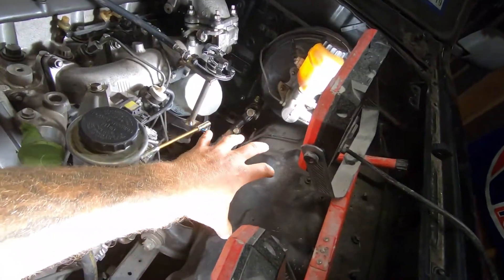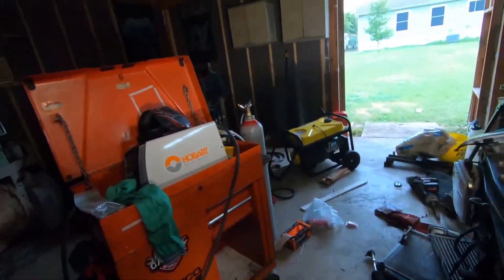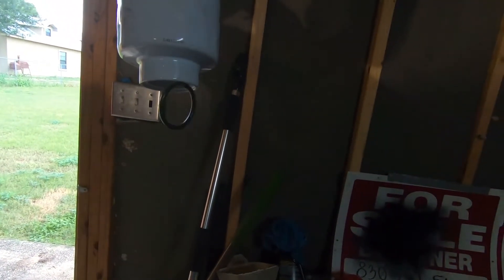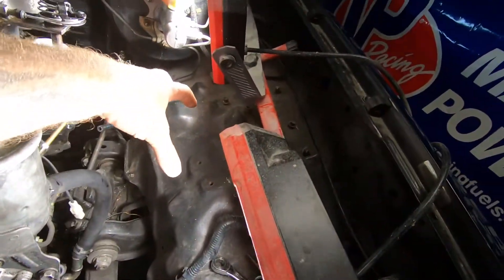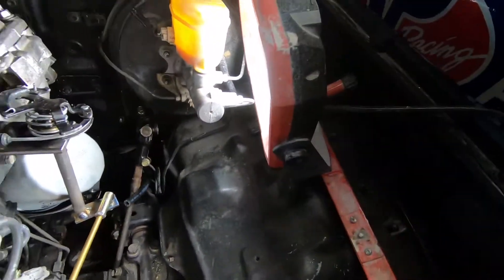Next I'm going to be working on the fuel system. I'm probably going to have a fuel pump, make a mount for the fuel filter — I've got the fuel filter housing shipped in from overseas. I was able to get this Wix fuel filter from O'Reilly's, it's the 33138. It does not come with the bottom fuel water separator sensor; I did find one at NAPA that's supposed to be coming in tomorrow. So hopefully I'll have the whole housing put together and figure out where to position and mount it on this fender well. Then I'm going to take the bed off the truck, run fuel lines, and clean all that up. Hang in there guys, we're going to do it one video at a time and get this all put together — I'll see you in the next one.